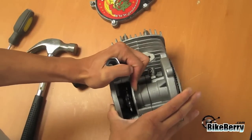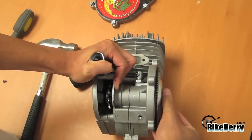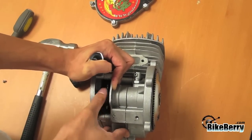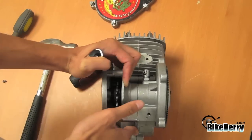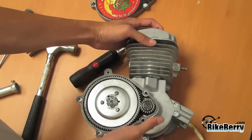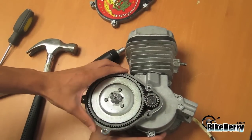You want to adjust the wing nut so the clutch cover moves an eighth of an inch when you disengage the motor properly. There you go. If the displacement is more than an eighth of an inch, your clutch will slip when attempting to start the engine. If it is less than an eighth, it will be too tight to disengage. Make sure you adjust it just right.